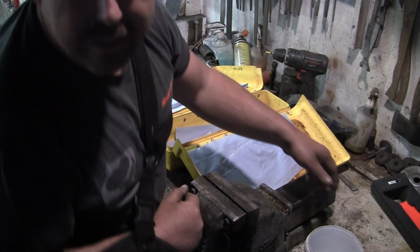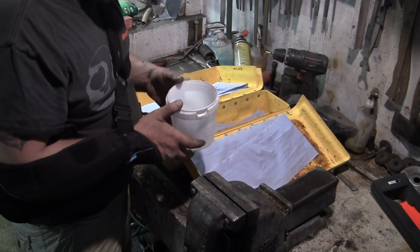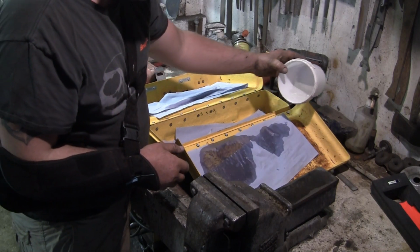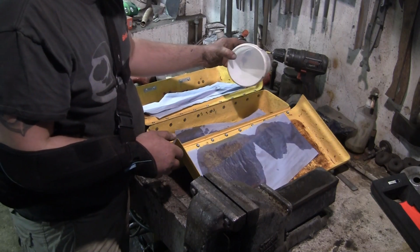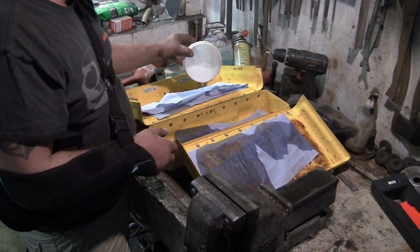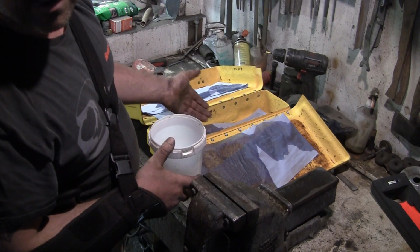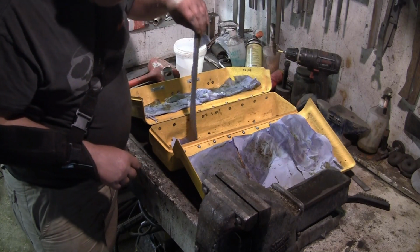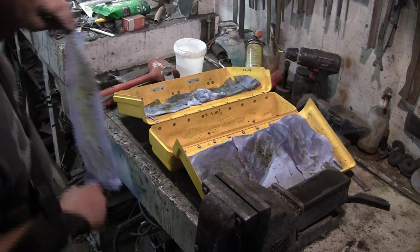Okay, when dealing with unwanted remnants of contact adhesive, the best thing is 3M solvent number 2, but I haven't got any, unfortunately. So what we're going to use instead is cellulose thinners, which does work, it just takes a lot longer, and it's a bit dodgier using it on unknown surfaces. Okay, so we're slowly lifting the glue off with the tissue paper.